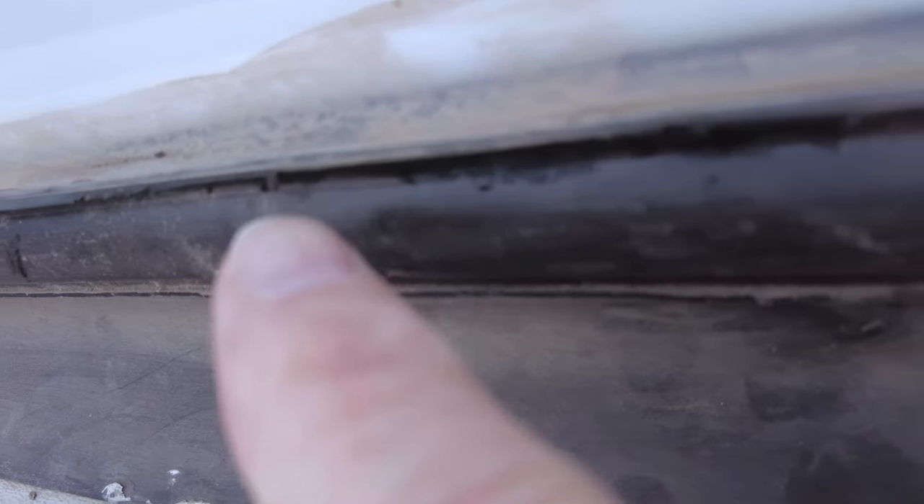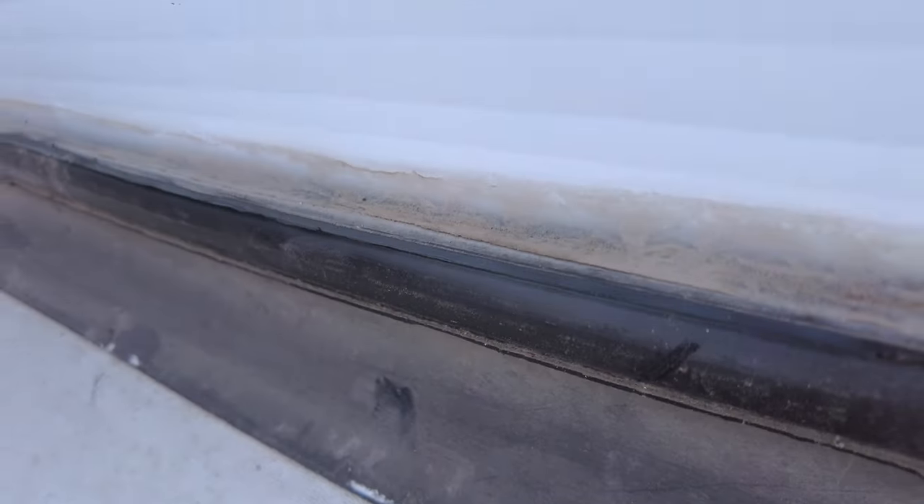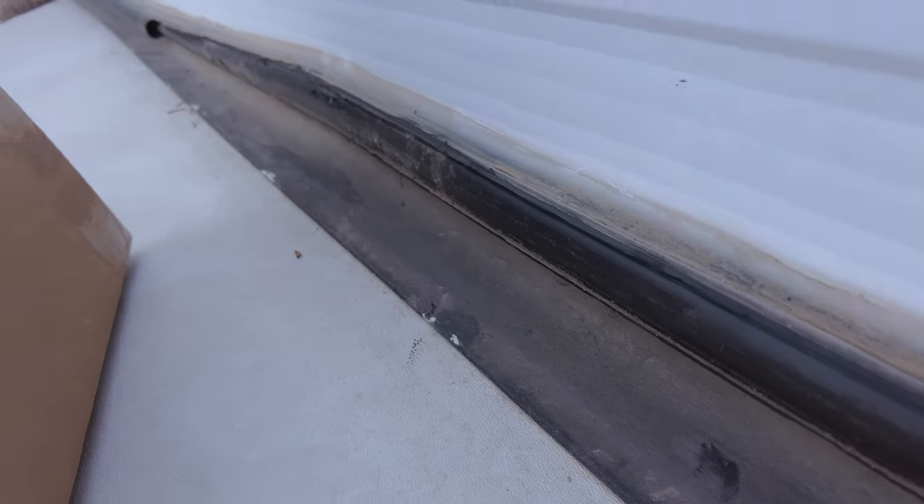I got one of my razor knives and carefully slid along the gooey part — the part that's rotting — of my upper seal. You can see what I've done: I've taken the razor blade and trimmed back both the top and the part where it was all corroded. It's not doing anything for me now, so there's no reason to have it there. I trimmed it back to where it's starting to be okay, where it's not gluey to the touch.